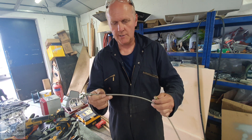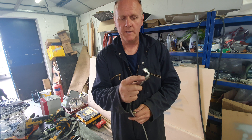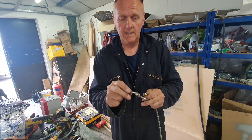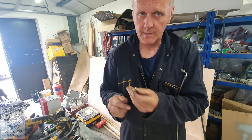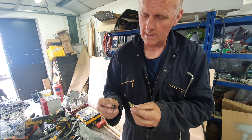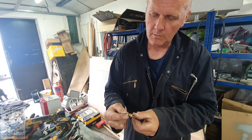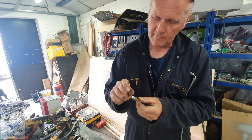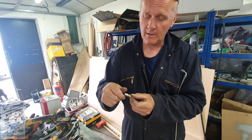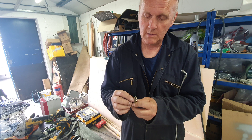This is the line we're talking about - you can see it's got a stainless steel braid on it, and inside it's got a PTFE line which is the actual hose that carries the fluid. Then you get these fittings derived from the aero industry, also used a lot in race cars and rally cars - and that is actually a reusable fitting. Inside you've got a little union which has a compression fitting, a bit like a plumbing fitting. There's a little olive, and when that goes over the PTFE hose and the knurled nut goes on top, as you tighten the two up it compresses the olive against the PTFE in the hose. You wind it fully down till you can't tighten it anymore and you've got a completely fluid-tight brake hose.